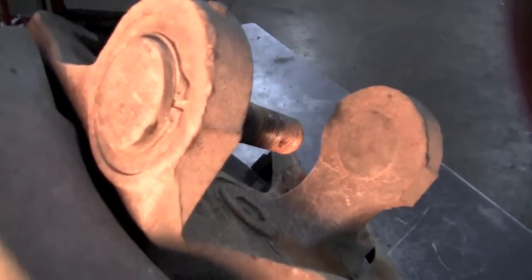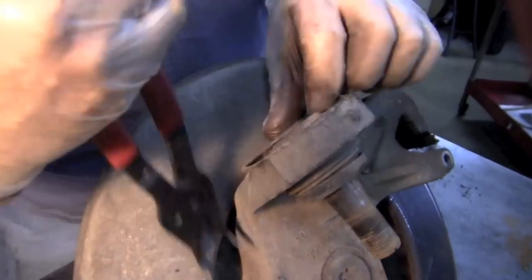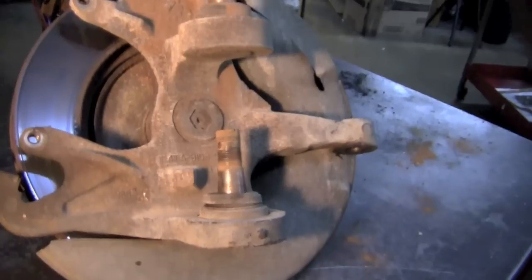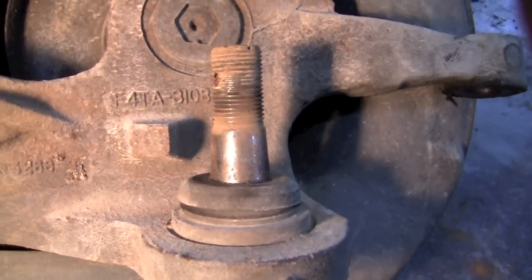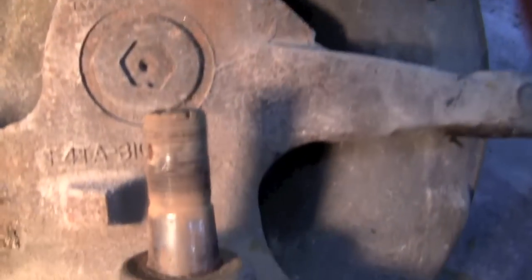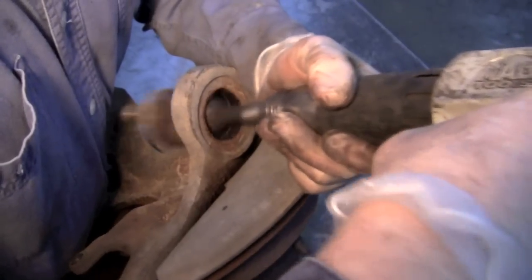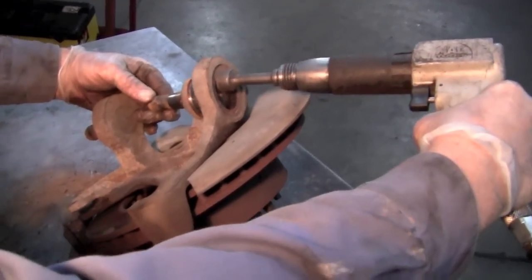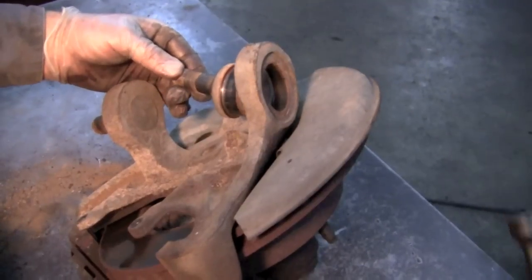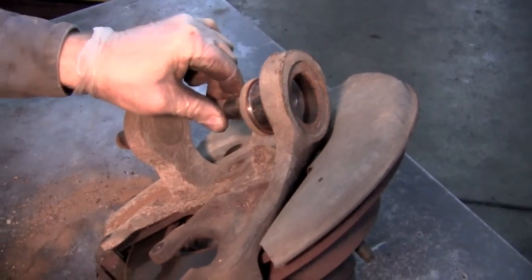Now we've got our knuckle moved over here to the bench and we've got to take this little ring off with your snap ring pliers. If you've never done these before, if it's your first time, just pay close attention right here. We've got the bevel — this is the bottom ball joint compared to the top. It's just a post up there; it doesn't have the bevel. We just showed you one method where you can use your air chisel and try to push it out this way. Sometimes that works real well. Other times it won't — you'll push and push and it won't work and you may have to use a press. But this method is much simpler and faster.